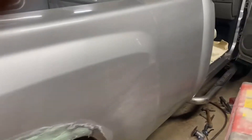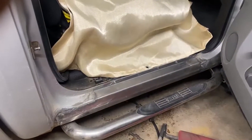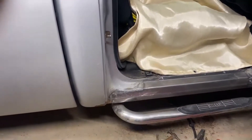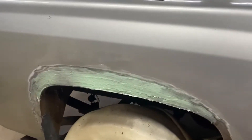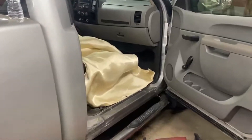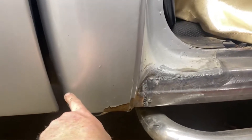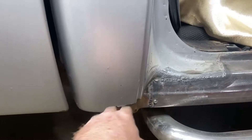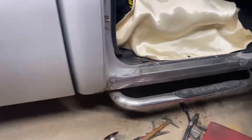It won't be long before we're doing some finished body work and some priming on these things. Our plan is to at least bare minimum have it in primer today and ready for paint in the morning. That's probably the most realistic. I'd love to have it painted today, but I'm not going to say that. Just having this stuff welded in and body work and primed would be a good point. I'd love to have it painted today, but I don't want to be unrealistic. So it'll at least be ready for paint today, paint it tomorrow. Fingers crossed, everything goes well, could be painted today. Maybe I'll get the jams painted today, and then we can shut the doors and do the paint on the outside. I think this one's just getting straight up paint, no rocker guard or bed liner, because it's pretty clean already. We'll save that step — save that for the trucks that are worse off. I mean we're going to put a little paint on that cab corner, but I literally will probably clean this up, clean the pits, maybe just get some good primer on there. And I might even just paint and blend the clear somewhere in here, just to keep it low and simple, keep as much factory paint as possible. But we'll see how far that goes when we get to that point.